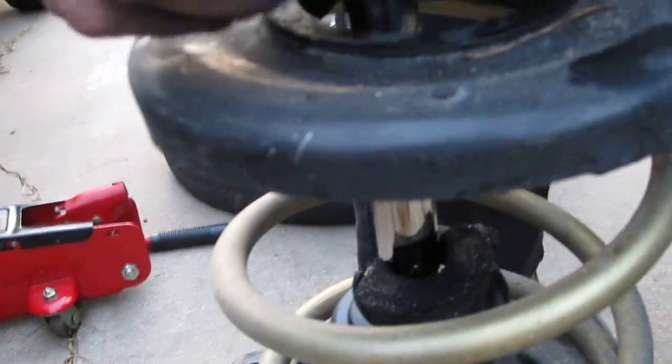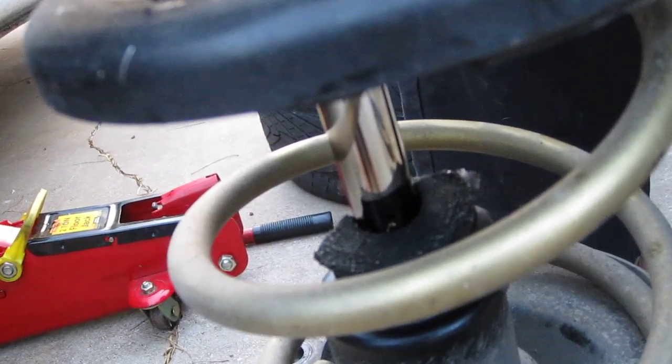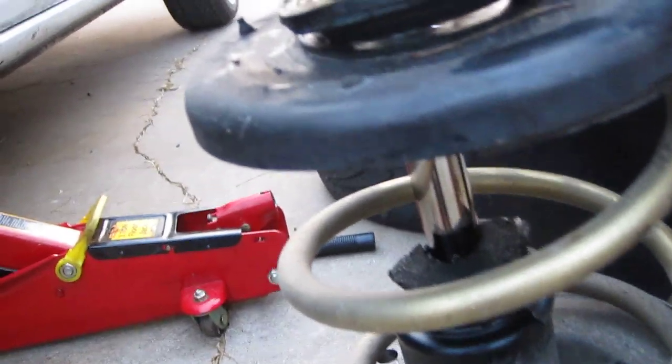Oh. And here's what's left of a wheel bearing. I mean a strut mount bearing. This bearing is totally destroyed. It's actually supposed to sit here, but there's supposed to be bearings between there and there. So I guess the spring coil was too low, yeah, too weak. Something about it didn't work out right.